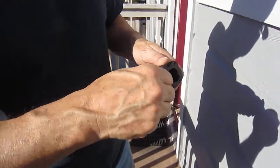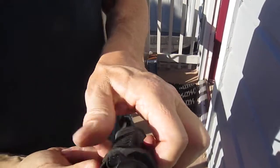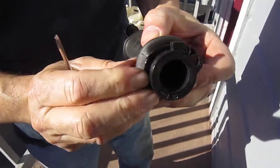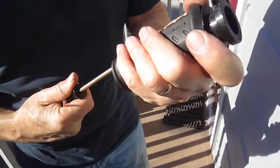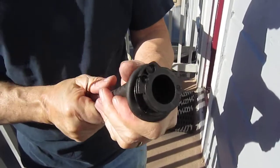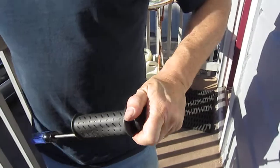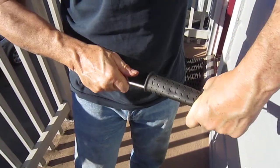With this screwdriver I'm going to lift up this lip here and peel it back all the way around. Since this is plastic, it's not as easy to deal with as if it were metal. So I've got the screwdriver all the way through now, and I'm going to start turning the throttle with the screwdriver as I push on the rubber handle.